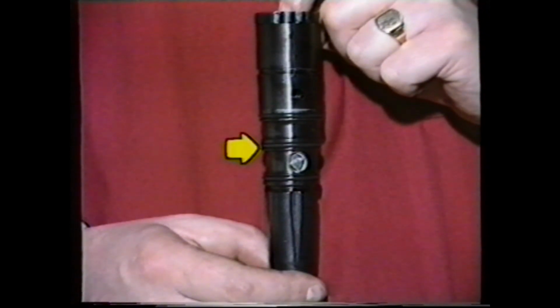The middle seal will allow fuel to short-circuit from the injector supply through to the return, resulting in a drop in fuel pressure, with a consequent power loss plus a possible pressurization of the return line, giving a slow die-down and run-on.